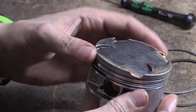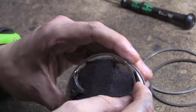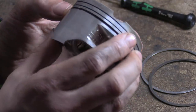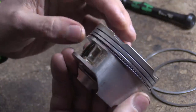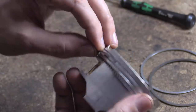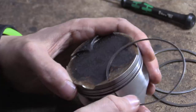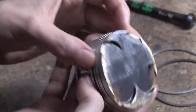This ring has a slanted bevel on the back of the ring — we'll look at rings in a minute. Oil control rings are the same kind of thing. These are really light and easy — just up like that, then move it around with your fingers and it just falls off. The actual spacer — trying to find the end — these can be a never-ending one. Take the next ring off the same way — just roll it around and she comes out like that.